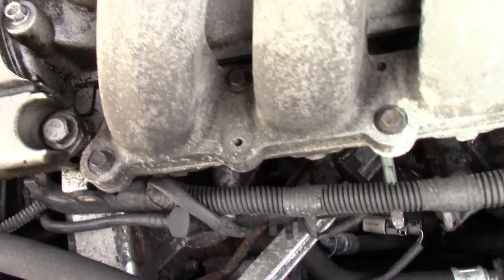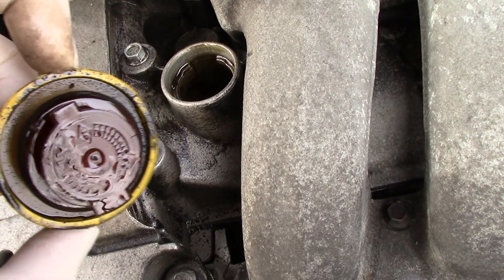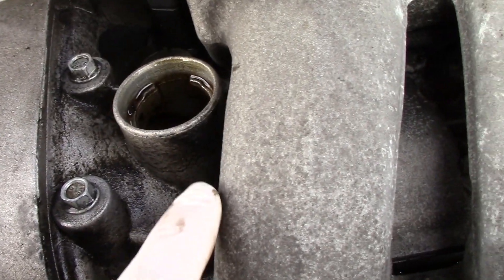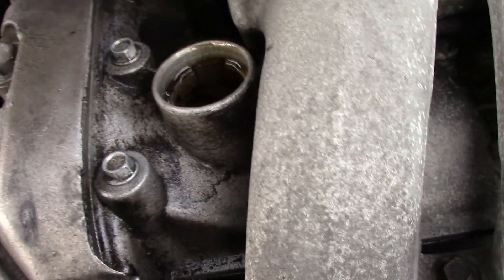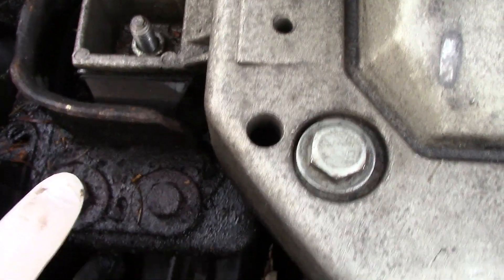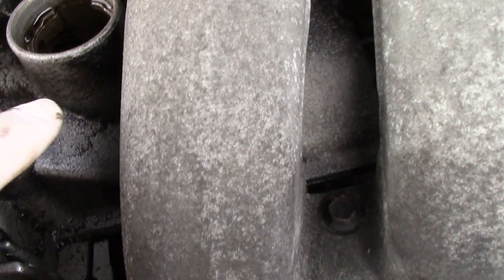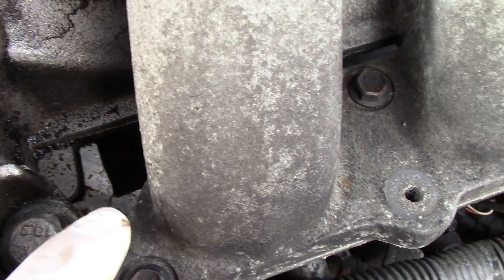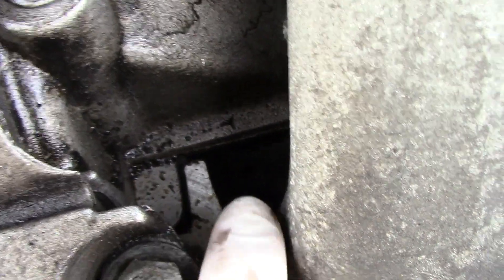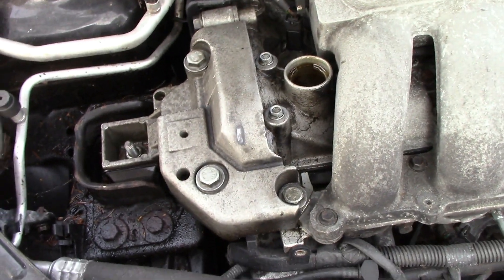So I really don't know what to think about it. We've got some oil around here. This is the filler cup, by the way, and filler cup seal — all looks okay. So I don't see why it would have leaked from there, although there is wetness around the outside of the housing, which suggests it could have leaked from there. Down in here there's a little puddle of oil, kind of at the top of the housing for the inlet manifold. There's a puddle there, tiny bits there, tiny bits there. But that's dry — cam cover's dry, cam cover's dry, cam cover's wet.